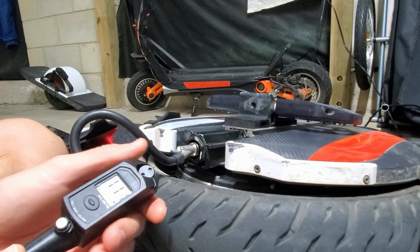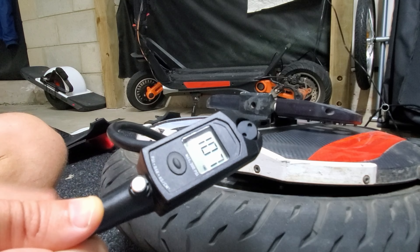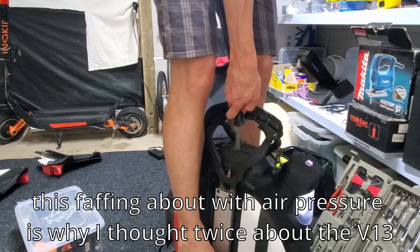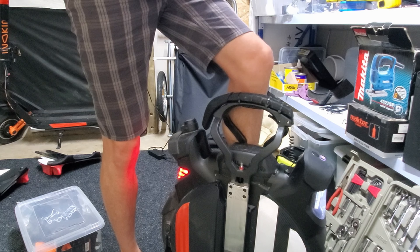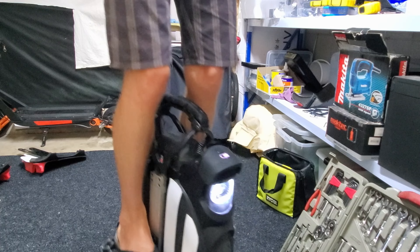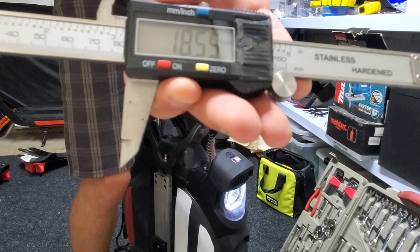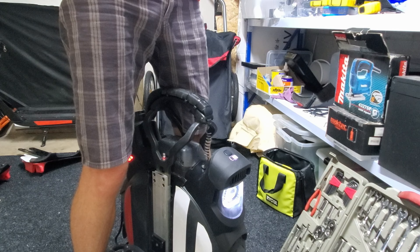I'm back in the garage after the ride to check how far off the suspension pressures are. When I flick the switch it should be around 110 — that's actually pretty good, 107 on the left lower chamber. I think what's happened is that because I've lubricated the sliders I'm getting a much deeper sag. Even without my riding gear, let's go for 120 and test the sag at that. This is feeling more like normal at 120. I'm going to leave it at 120 PSI giving me 18.5mm sag — once I get my riding gear on that should put me up around the low 20s, which is what I want.